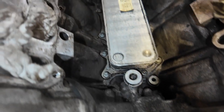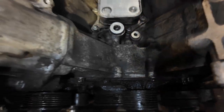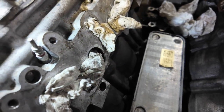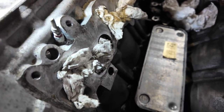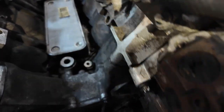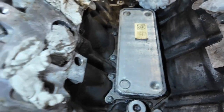Okay, we have this just about clean enough to take the oil cooler out and replace the seals underneath while I have it this far stripped down. I'm going to remove each and every glow plug seeing as they're super easy to get at right now and make sure there's no seizing in all those threads. Because there's nothing worse than having a glow plug break off in a cylinder head whenever you need to change it. I'm going to go ahead and do that while it's easy access, and get some penetrating fluid in everything now it's all cleaned out.